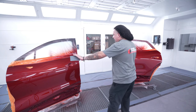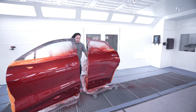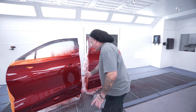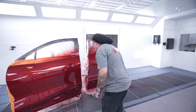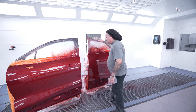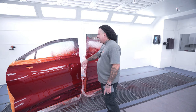So try to get your panels lined up. I see some guys, they'll take some of these panels and they'll roll them over and put them next to each other so that they can walk the whole side of the car. And sometimes that's a good way of doing it too, if you're not too comfortable with them being separated. I like to have them separated. That way I can just act like this is a square, like I've shown you guys in some of the other videos. Take it off the panel, make like you're spraying it in a square, the same thing we did with this one. And that way when everything goes back up, you guys can see here that this is going to match up perfectly, because we did the same exact thing on everything, with the sealer, the ground coat, the Kandy and even the clear coat.